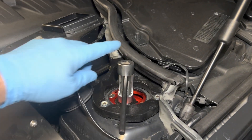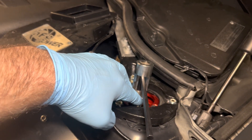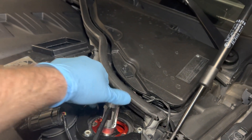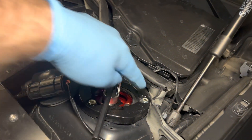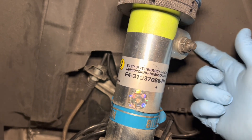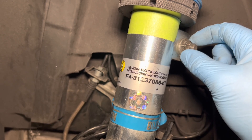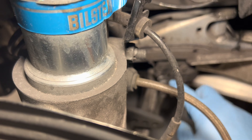Finally, don't forget to torque everything down. Your top mount for the front strut is 47 foot-pounds of torque - use the 7mm Allen key and a torque wrench to tighten that down. The front strut tower bolts, these three 13mm bolts, torque down to 25 foot-pounds. And finally down below, the top bolt that goes onto the end link - you'll need a 19mm in the rear to hold it and stabilize it, then a 16mm here, torqued down to 42 foot-pounds. On the driver side, don't forget to reconnect your headlight adjuster.